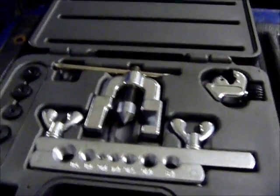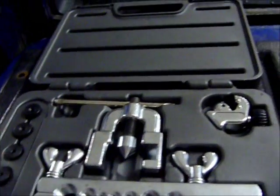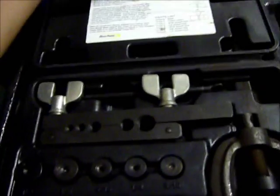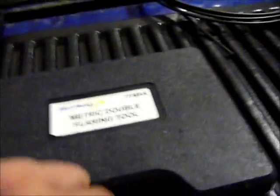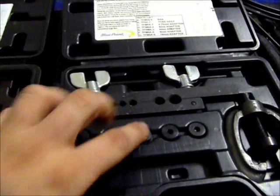All these kits are going to look very similar, but the little chucks here — these bits — will be very slightly different. This is a bubble flare kit, so it actually has a bubble instead of a double flare. This is our standard double flaring kit, very similar to this one except this one doesn't have a built-in cutter in it. And there is also this kit which will make a metric flare, mostly used for European and some Japanese vehicles. Very similar in the kit — the only difference is the actual size of the block and the actual fitting.